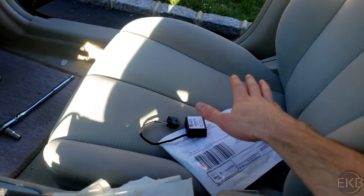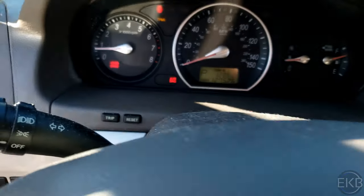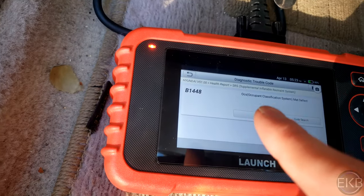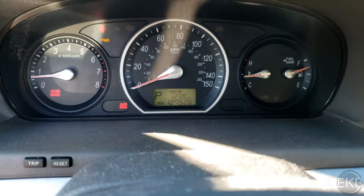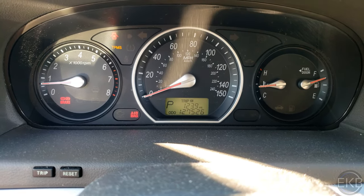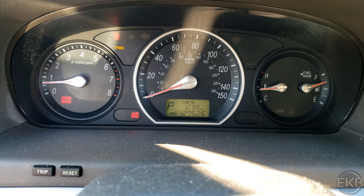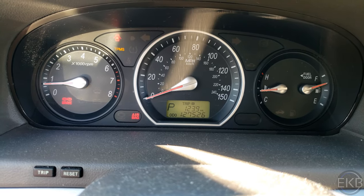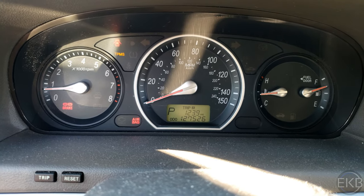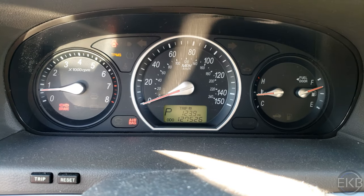Now, if there is no one on the seat and this light is off — in other words, the car thinks there's someone in the seat — but the airbag light is on, and also if you see the fault code, then there's a good possibility that your sensor is bad and it needs to be replaced. If your car is under warranty or if there's a recall on it — some vehicles and makes and models there may be — this is a 2008 Hyundai Sonata GLS, so either we would have to pay a few hundred dollars for the mat, the sensor, replace it ourselves, or go to the dealership and pay up to like a thousand dollars, depending on make and model, and have them do it for you.